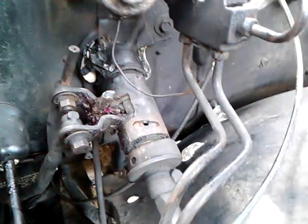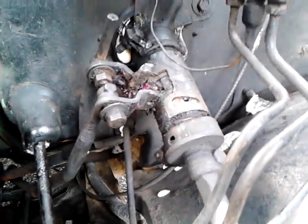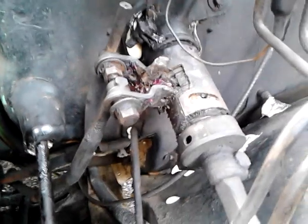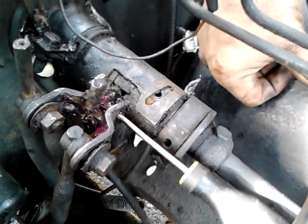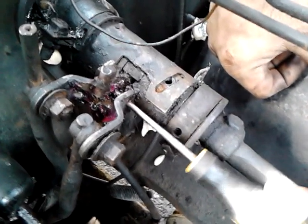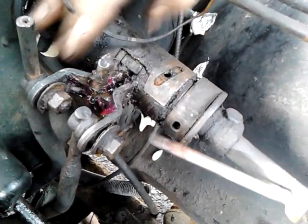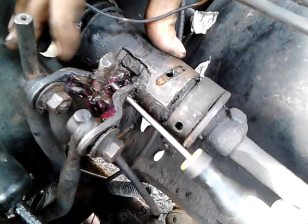After this thing comes off and gets out of the way, you're going to want to align everything in neutral. You want to make sure that your shifter is in neutral on the inside. Then you're going to want to take a screwdriver that will just fit through this hole right here, through there, and through the other one. It goes through, but it had to be forced. That means I need to loosen this up, because that should just slide right up through.